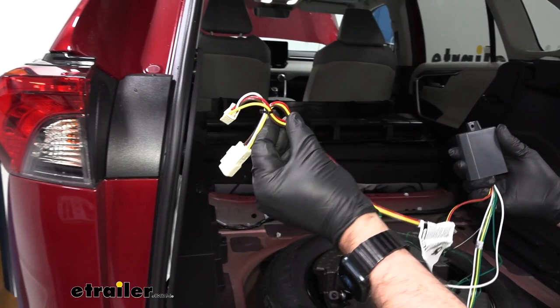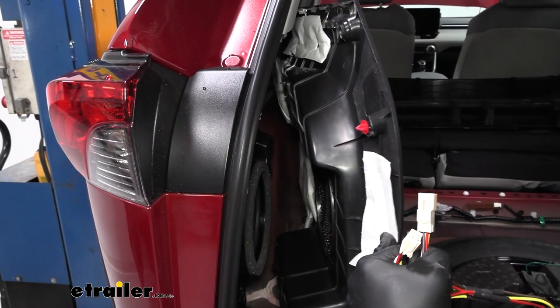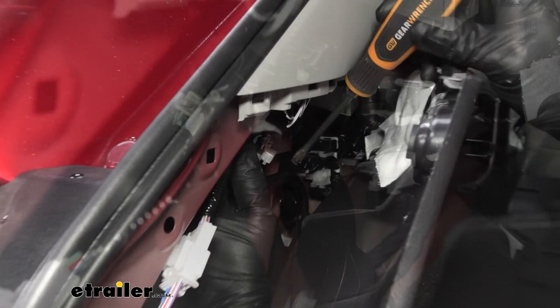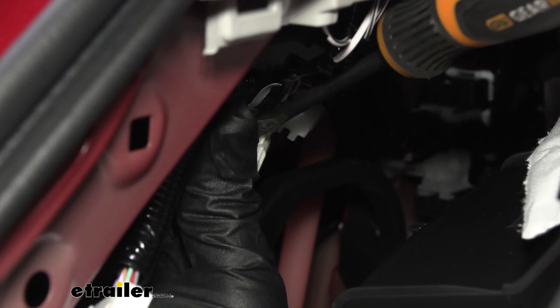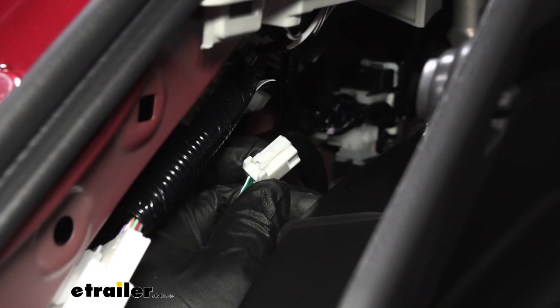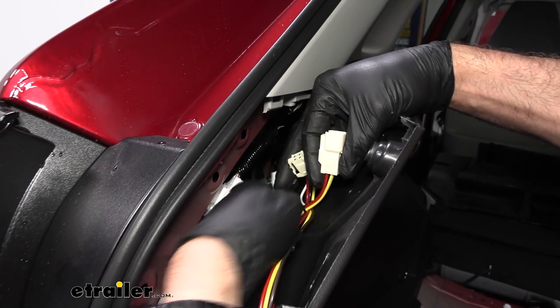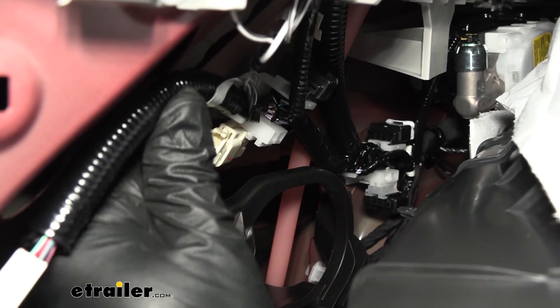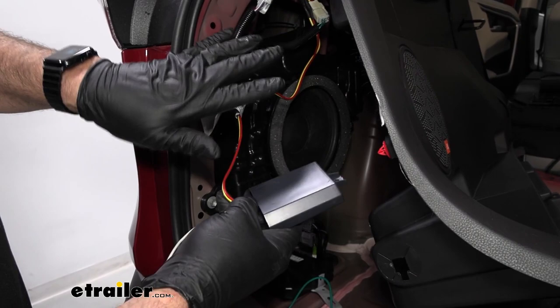We're going to be looking for the left side, the driver's side, and it's going to be these colors: yellow, white, red, and brown. The connector that we're looking for is going to be this one. There's a tab here — if you're having trouble getting back here, go ahead and grab a flathead screwdriver. Push down on these two center tabs and then pull back — that'll help you disconnect it. Take our wiring harness: one end will fit and plug directly into our connector, and the other end goes into the other empty spot.